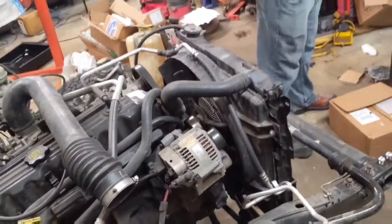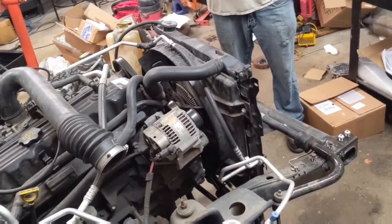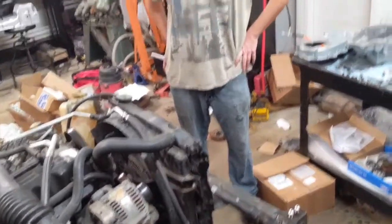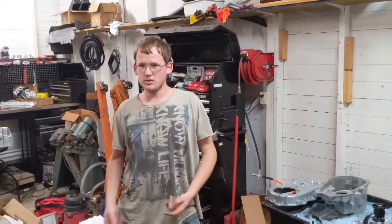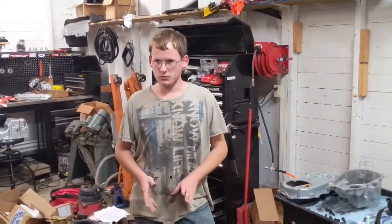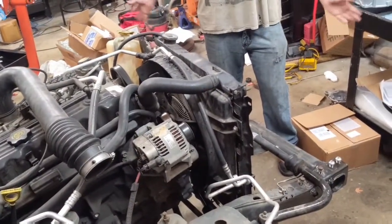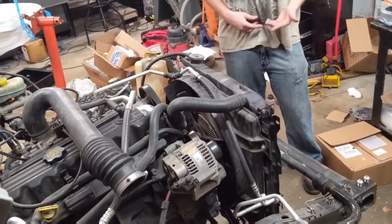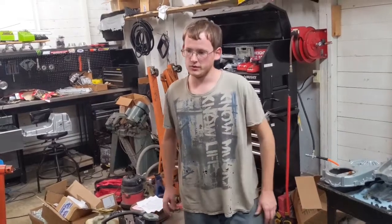But basically, these 4-liters are hard to kill. It's kind of painful to take out a perfectly good motor and a good Jeep, and all it is that freeze plug on the back, which is somewhat labor intensive because you have to take the transmission out, the flywheel. So while you're out, you may as well do it. It's a job on its own. So at this point, might as well just do something cool. And the 4-liter, at least, should help fund the LS swap. Exactly. And a good running one would probably net some pretty good money.